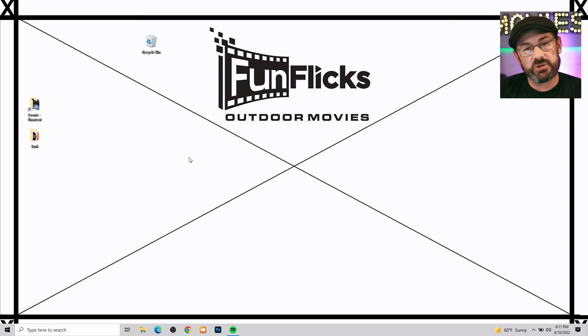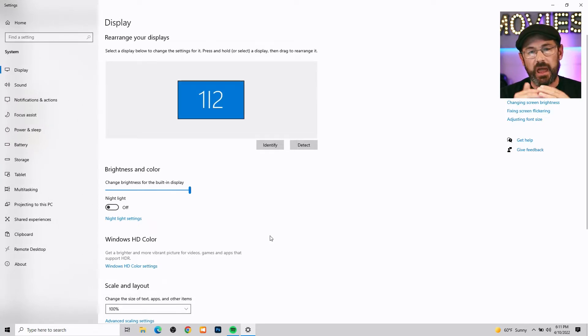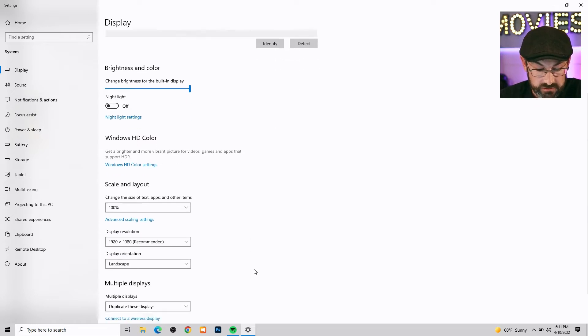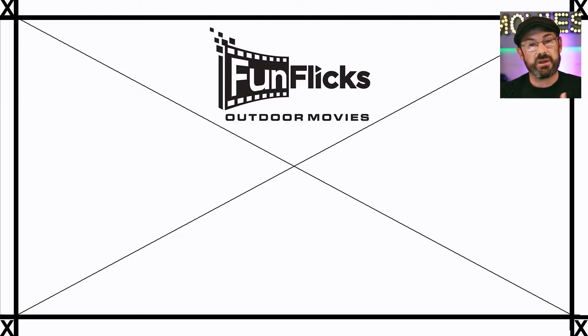Let's have a look at that right now. The quickest way to get to display settings: you can type 'display' in the start menu, or right-click on the Windows desktop and hit display settings. Right now we are in mirror display — what I see and what is on the second display are exactly the same. To change that, scroll down to 'multiple displays' and instead of 'duplicate these displays,' select 'extend these displays.' Now we have two separate displays.